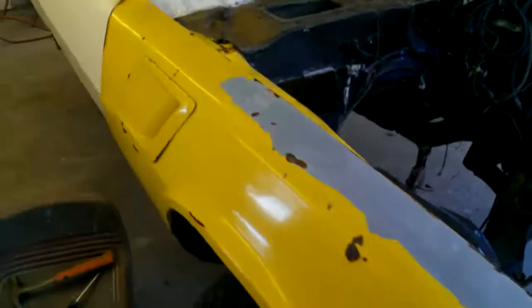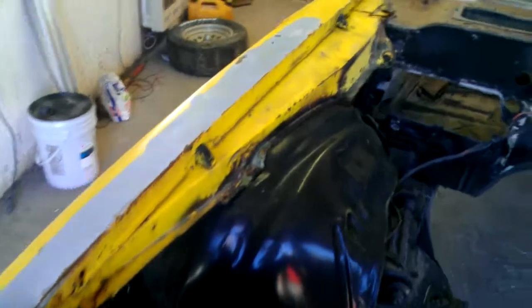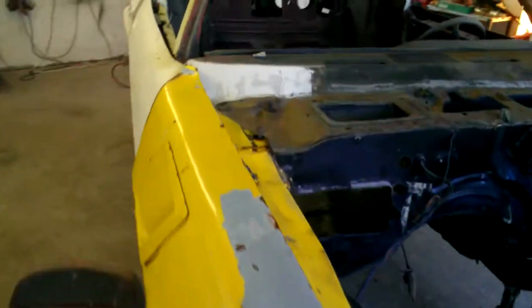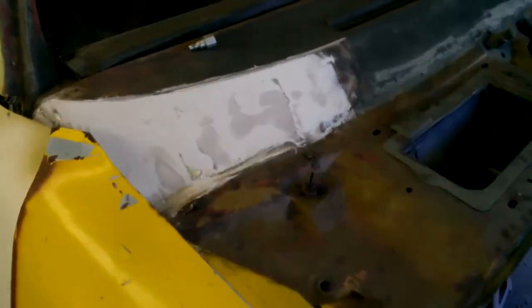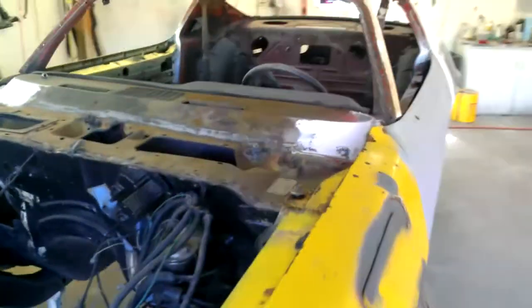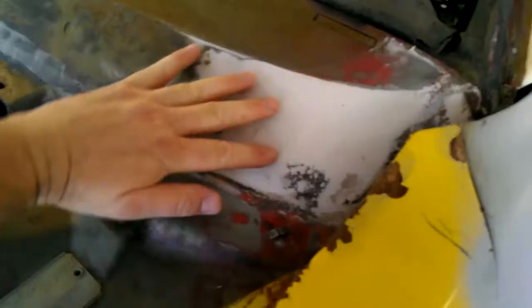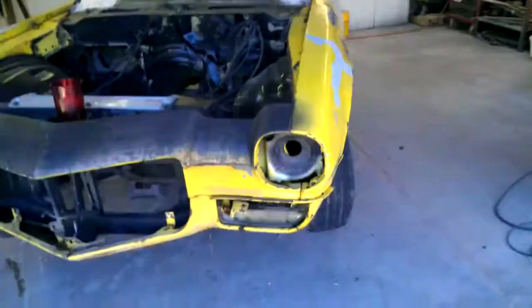Anyhow, here it is — I went ahead and put the front cap on it so I can get cranked up on some other stuff. If you stay on one thing too long it kind of burns you out. I welded some patches right here and got them filled in with some bondo. Some people don't like to use bondo, but bondo is bondo — they like to call it body filler, whatever. I welded the patch in here and got it ready. I put some etching primer on it but apparently I didn't put it thick enough — it's got some surface rust on it. I've got to go ahead and sandblast this and get it in some epoxy primer as soon as I can afford it, but stuff's expensive, so just doing a little bit at a time.